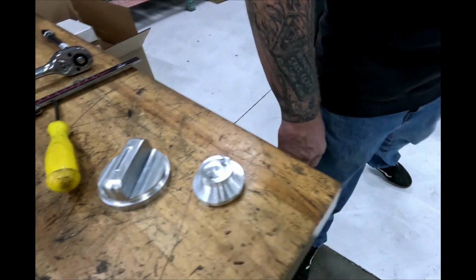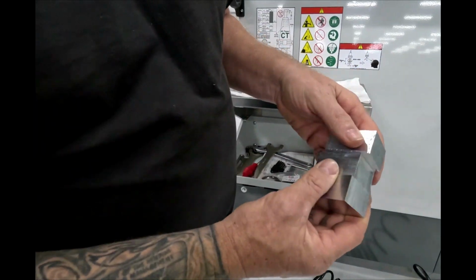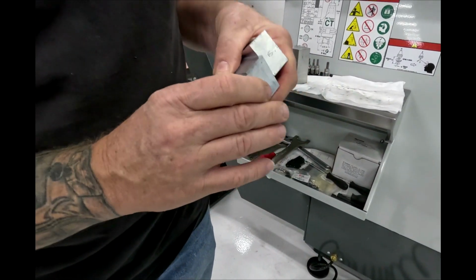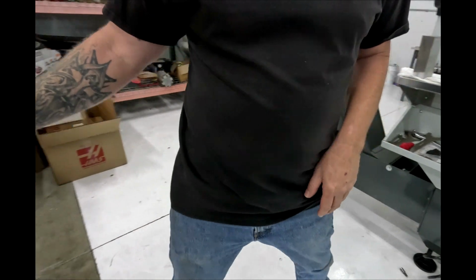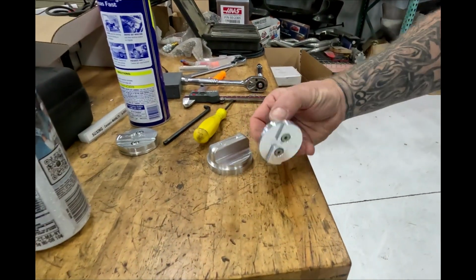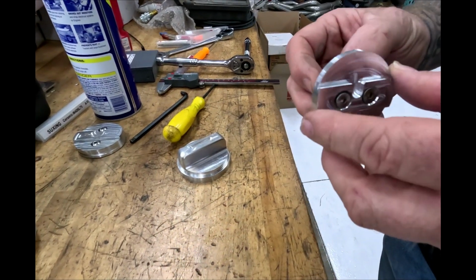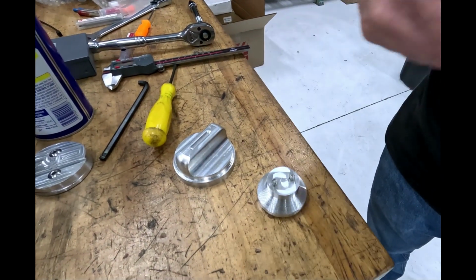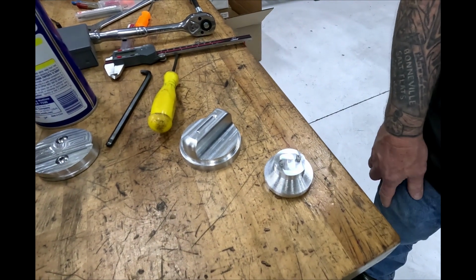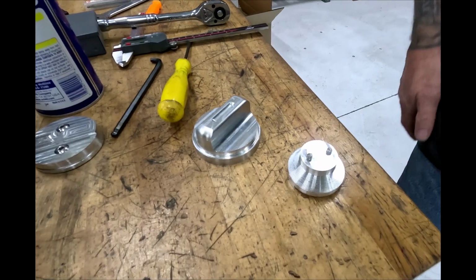And he's got some blocks machined squarely, and then he'll machine the top side of this like he did the other. It'll go on that part that he made. This fixture, it'll mount to this fixture, and then he'll be able to do the last part of the machining process. And we'll look at that either later this afternoon or tomorrow.